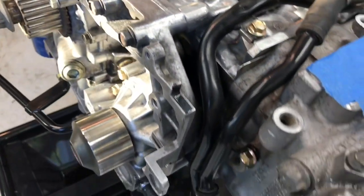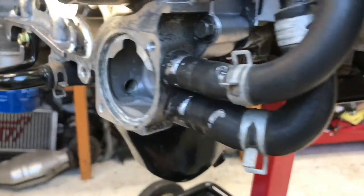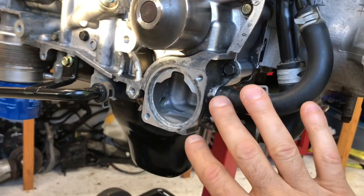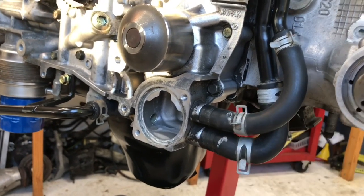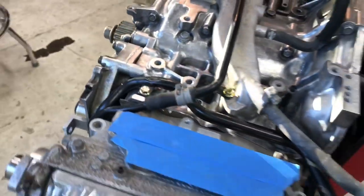Follow this black hard line down along the engine — you can see how it weaves down along the front of the engine, through a couple of hoses, and then ties into the water pump at the front of your engine. Remember, this cavity down here is where the thermostat is and where that fresh cold coolant is being drawn into the water pump and pumped through your engine. That's pretty much what the kit looks like when it's installed.